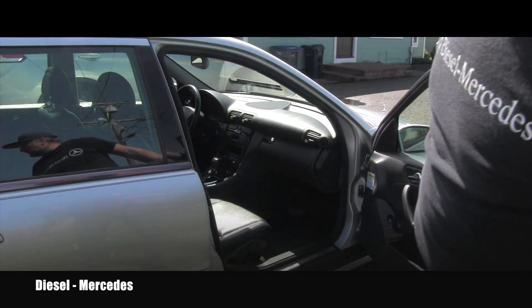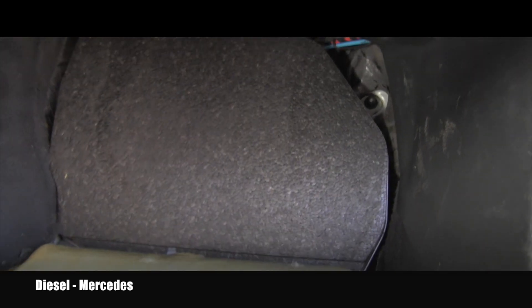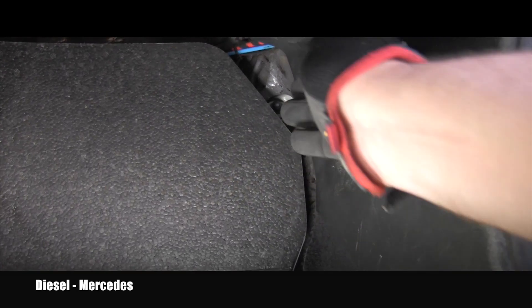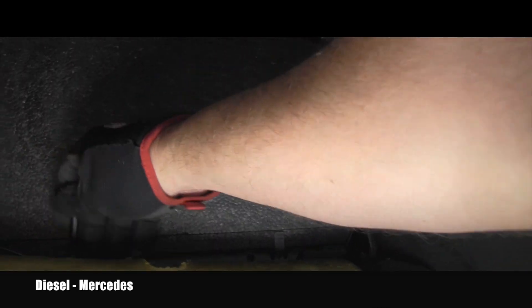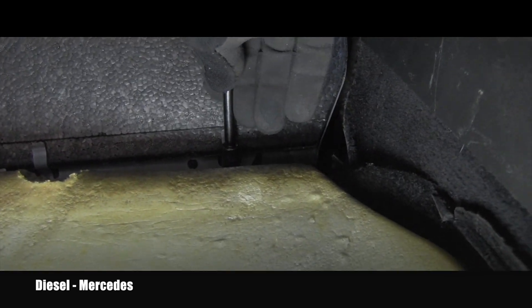So enough of the books — let's try our luck. I remember that in many cases these computers are located behind the kick panel, so let's see if I can remove it without taking apart more stuff. That plate is held by three 10-millimeter bolts: one is up here, one is here, and one is right here. I'll go ahead and remove those, and that should give me the possibility to move it and turn it towards you.